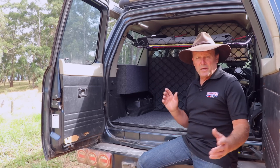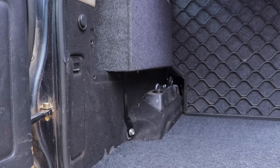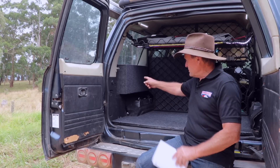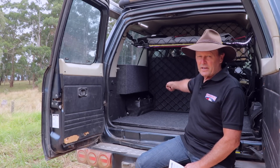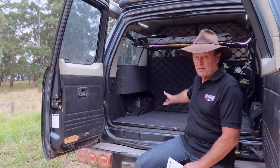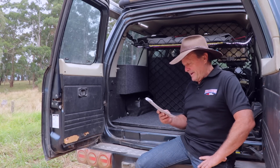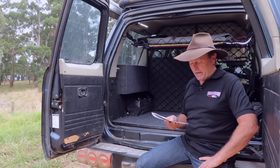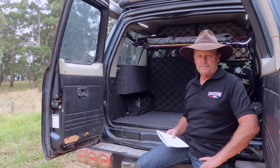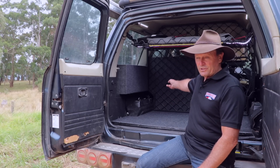Manufacturer's specifications — what does that mean? Because most people think that you can mount a lithium battery in any configuration you want — lie them down, stand them on the ends, whatever. Well, apparently not. When I got home, I thought I'd go through and read the manual. There's a Q&A in the back of the book and it says: 'Can I install my lithium battery on its side or on its end?' Answer: No. Far out — and this was while it was still mounted on its side down under there.